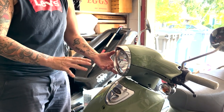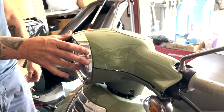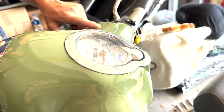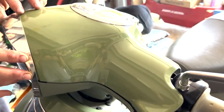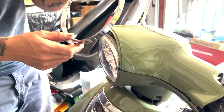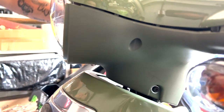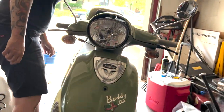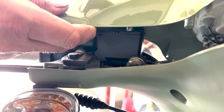When I first came up to the bike I had no idea where the master cylinder was because it's completely covered over here. I could tell from this little kickout that it must be under there, so this whole fairing has to come off. First I took off the light ring, which is held on by a screw, then there were screws on each side and the rest was held in by plastic clips. Once I pulled it away I had to disconnect the speedometer cable because I couldn't pull the fairing far enough — it just threads on.